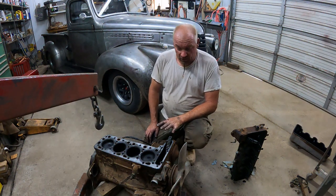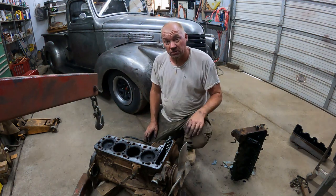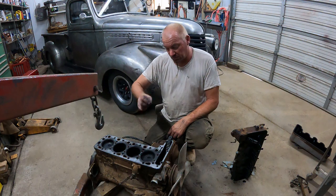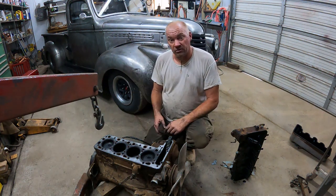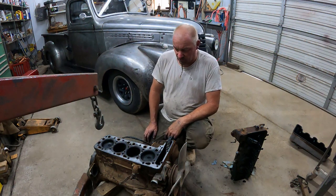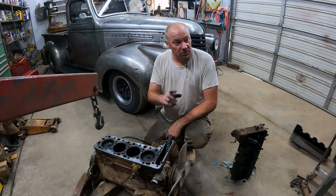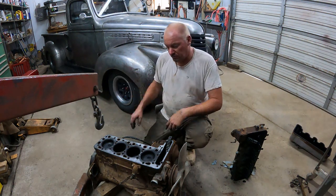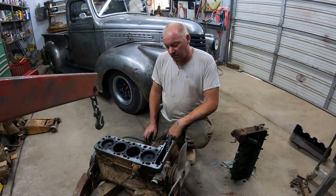I showed a little how I do the drip feed method. Everybody makes a different line, but basically you need this bent line to see the drip. If it's in the car, you don't need to set up a fuel system or anything. It all works from the car. Just be careful if you let the engine sit without the delivery valve and you have some build-up pressure in the tank, it could drain your tank through the pump if you don't watch it.